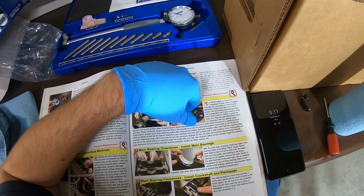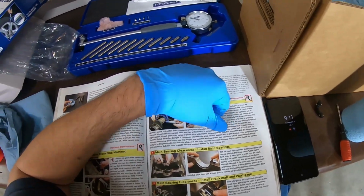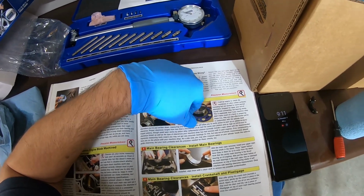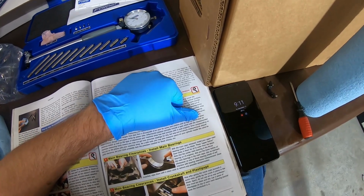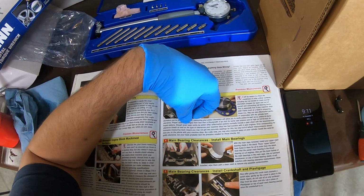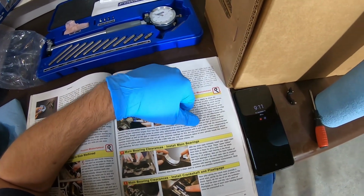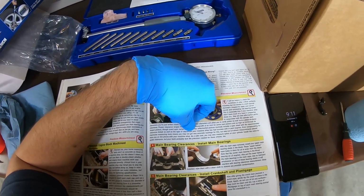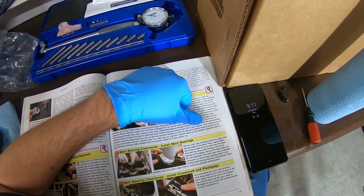In conjunction with the cylinder bore diameters you've just written down, measuring your piston diameters will allow you to verify piston to wall, aka piston to bore, clearance. Proper clearance ranges from less than 1/1000 of an inch for some cast pistons, as high as 1/100 of an inch for forged pistons. The exact specs vary by piston alloy. Aftermarket pistons normally include a spec sheet with the recommended clearance listed, as well as the type of clearances that your machine shop has had success with in past engines.